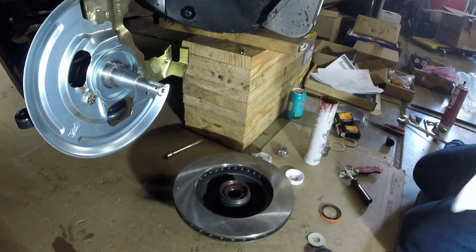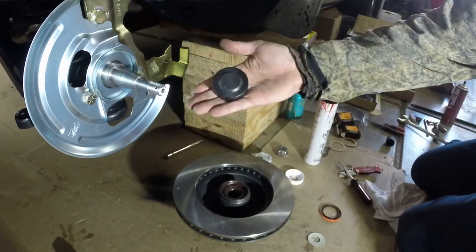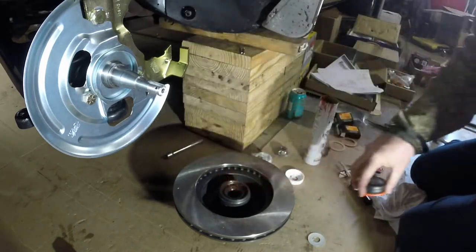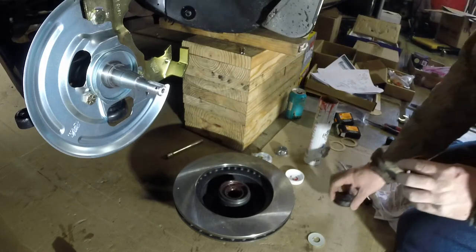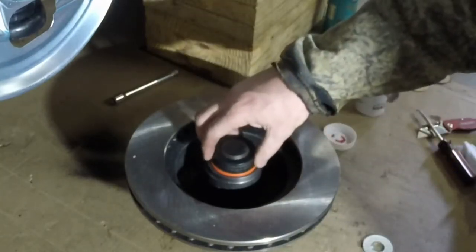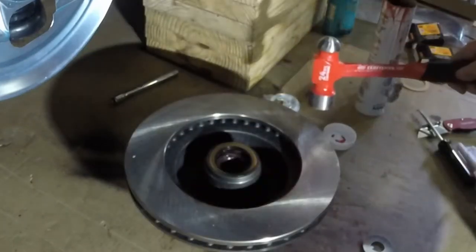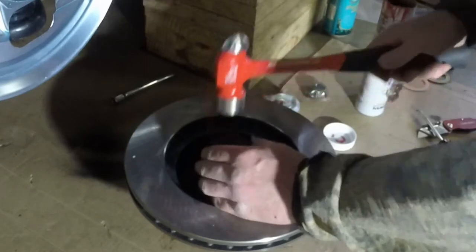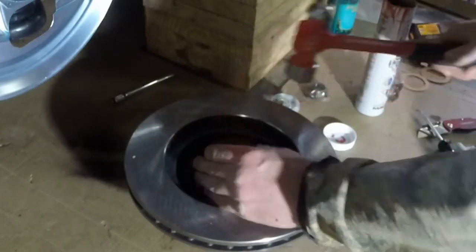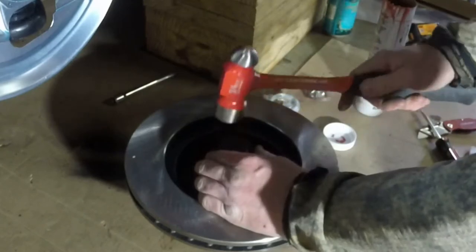What I've done here — from my ball joint press kit, I've got this cap. This cap fits really nicely to help me punch and seal the rear bearing in. So I'm going to set that in place and set this cap on it. When it's down all the way it'll have a different sound. That's pretty solid.